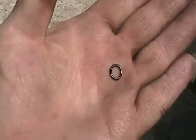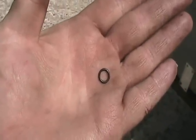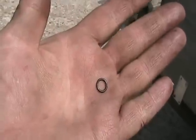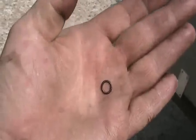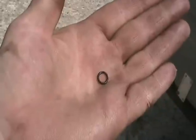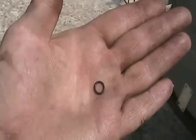On engines with the O-ring slinger-type valve seals, they often get very hard when the motor gets old, usually over 20 years old, and they just break. A new person starts driving that car, starts revving it high, and those valves are slamming up and down at a much higher rate than they're used to. The hard rubber just breaks, and you end up with all these little pieces in your oil pan, and all of a sudden your engine starts burning a lot of oil.